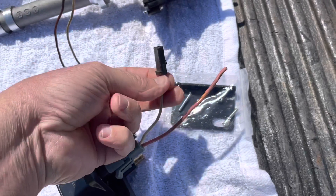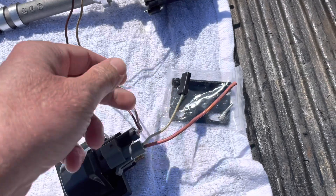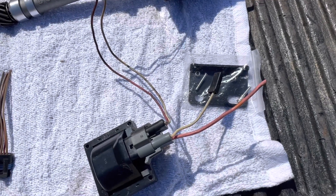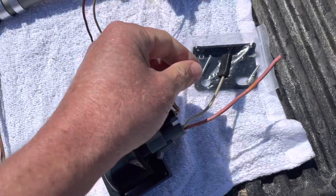The white wire — I'm going to cut that black connector off, put a bullet connector on it, and attach it to your gray wire at your coil. This is actually your tach signal. That gray is spliced somewhere in the harness and goes back to your tachometer signal through the boat harness. It's on pin number two in your boat connector — that's what runs your tachometer.